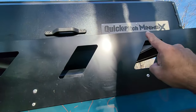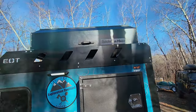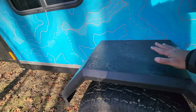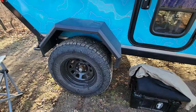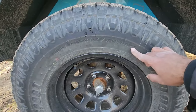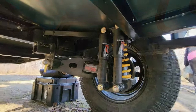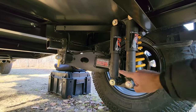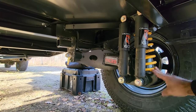On top it was also equipped with a quick pitch Mini Max tent. The fenders were nice because you could also use them as tables if you wanted. The tires were a 285/70/17 — a decent size for what you need, though you could order them a little larger. The suspension was built by Cruisemaster: nice dual shocks with a full spring setup, fully independent.